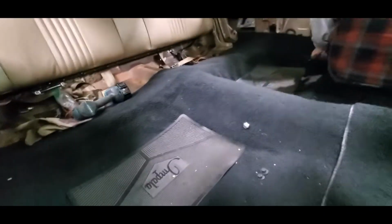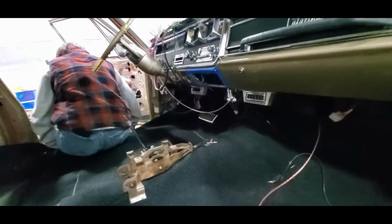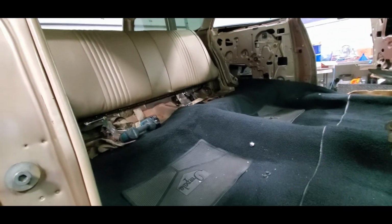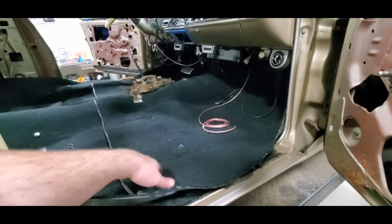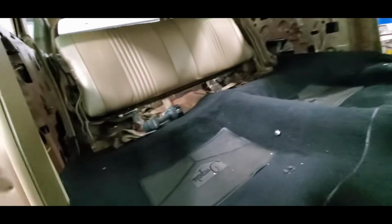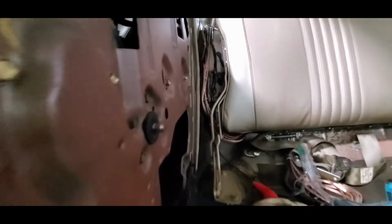Yeah, and those are mats out of the Impala. They're just helping the back so that we knew where to do things. I don't personally like to cut these until we have to. I'm going to wind up cutting up here and over there as I finish up some wiring. The rest of this, Pixie can trim out when they're ready to do sill plates. Sill plates never cover as far as you think they do. In fact, we've even talked about maybe just putting the original sill plates in the short term and getting this all welted in those. Because the last thing I like to put in is the sill plates, because they get beat up. You know, and for as thin as they are and as expensive as they are, let's not beat them up. You can see plenty of clearance.